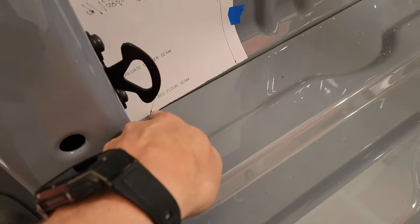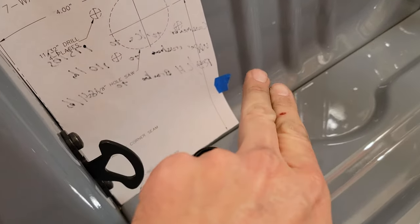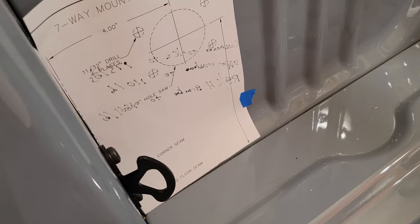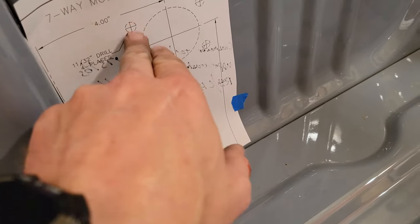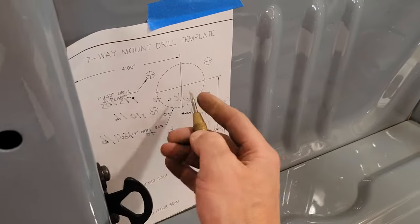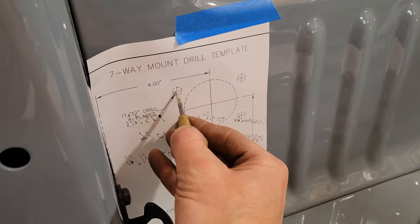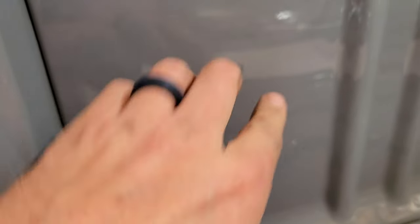Seven-pin is pretty easy — I'll go through every step. The instructions say 17 and up; although the website shows 23, when you print them out they're the same exact instructions. You will need the template — you sure do need it. First, cut off the edge with scissors. You'll need some painter's tape. The template shows 'bed to floor seam here' and 'tailgate corner seam' so you can see where the center of the holes will be. You need a 2-1/8 inch hole saw and four 11/32-inch drill bit holes. Use a center punch to mark the starting points.